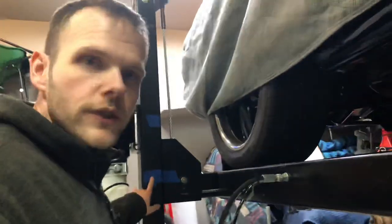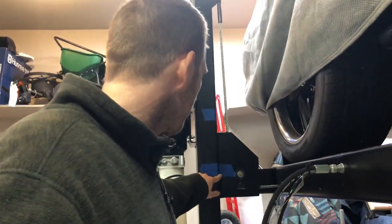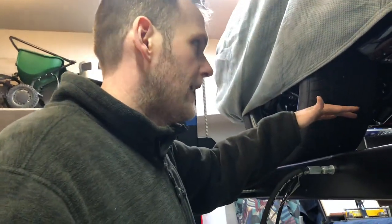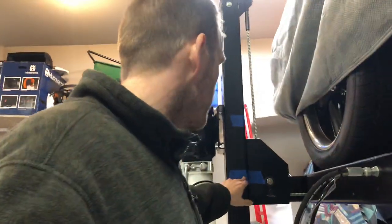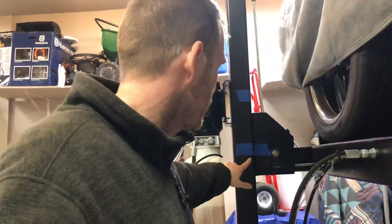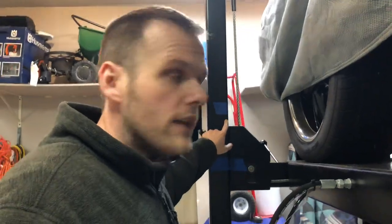What I do is put a little tape mark depending on which car I have on here, so I can line up. I've got two marks right now: one is 'TA front raised' — that's when I have the Trans Am up with the front wheels off and raised up. I can usually bring it to that rung and be fine without hitting anything. It's also the same mark for my Chevelle. Since the Chevelle is a little bit taller, I drop it there. If I had the TA on the lift just sitting normally like the Chevelle is, I can bring it up to this rung here — that's about where my head is.